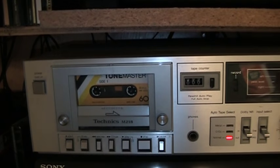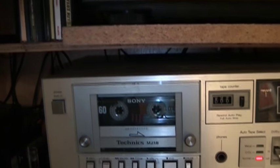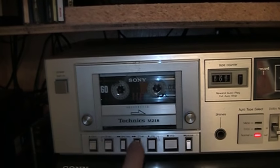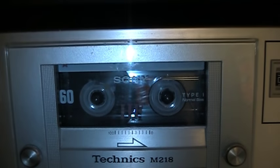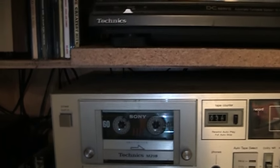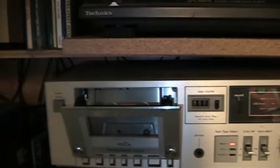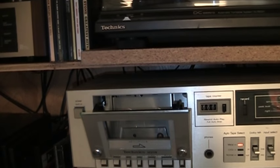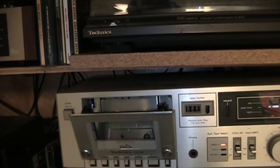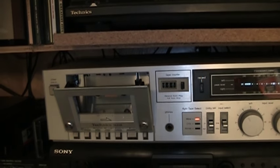You can hear the little squeaks and chirps of dissatisfaction, probably because any lubricating sheets separating the tape reels from their casing are not of very good quality. The Maxell communicator tape has gone on — I think it's actually out in my truck right now — so I have a garden variety Sony Type 1 HF series tape, a relatively inexpensive low-end cassette tape. But as you can hear when I start it up, it runs just about silently, as the ToneMaster tape certainly should. I got a lot of comments in that video, including one person who mentioned that ToneMaster was the only tape they had ever used that printed through on them. Print through is where a magnetic signal actually travels to and is applied to more than one layer of tape, resulting in a faint artifact of a signal being left behind as the tape rolls around to the point where the signal was supposed to be placed on the first portion of tape, but ended up going through to another portion that shouldn't have received that signal.